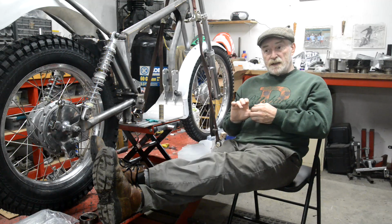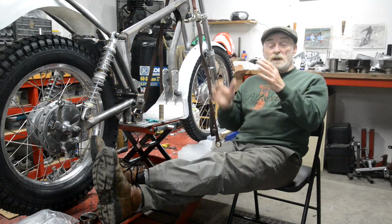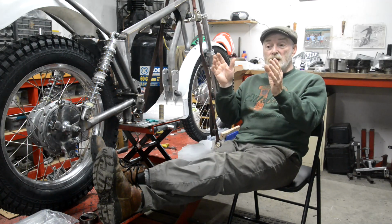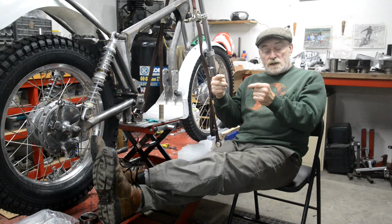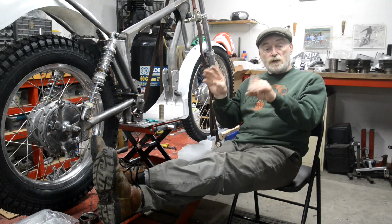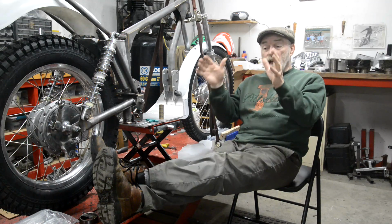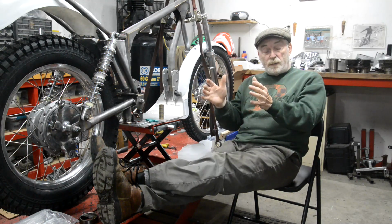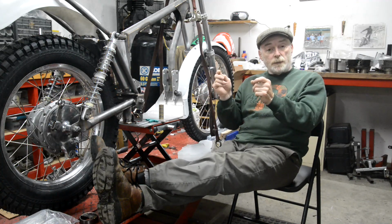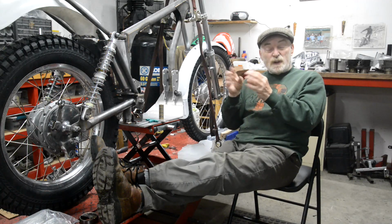So we'll do that, and hopefully during the course of the week, because my normal supply didn't have the couple of bits I wanted, we should be getting a new tube for inside the crankcase, the sludge trap. So what we'll do is, as I say, we'll get bearings in the cases. We will put the new sludge trap in the crank. We'll do the conrod so they can be bolted on. I've got new conrod big end bolts and nuts coming. And then we could actually put the bottom half of the cases together with the crank in. And I've also got coming that little needle bearing that goes inside the kickstart.